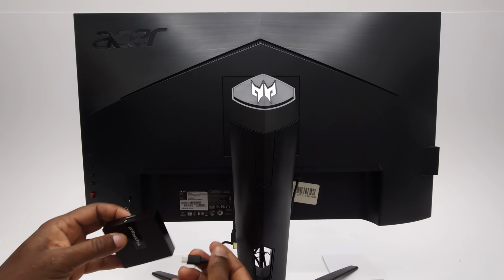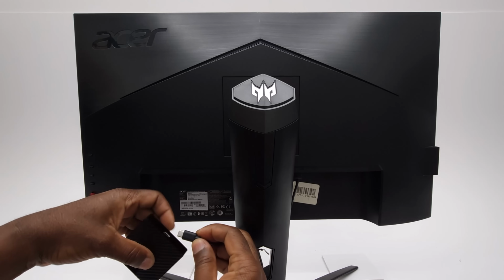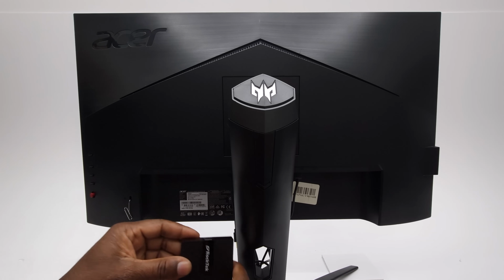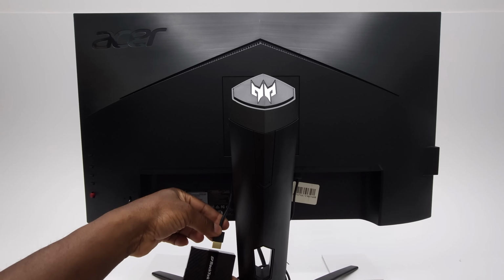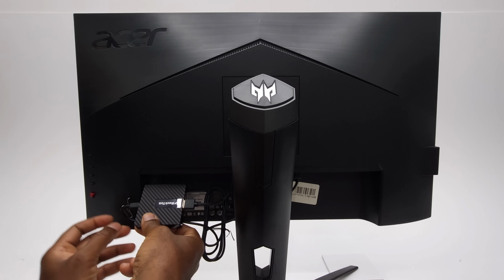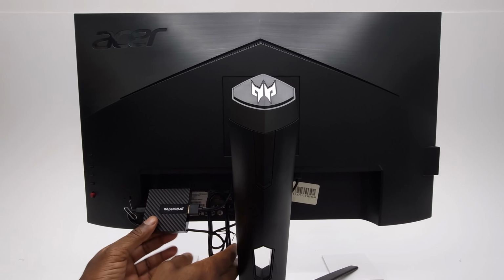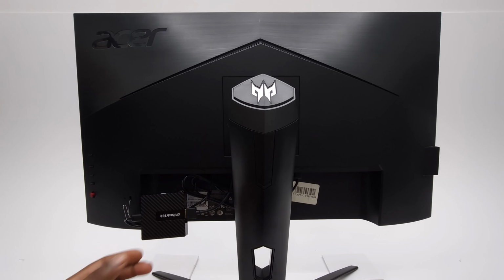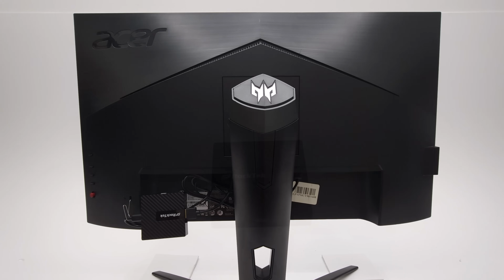This is because it's designed to sit behind your TV or monitor and be powered by one of the 5V USB ports. And the 6-inch HDMI cable is sufficient to reach one of its HDMI ports, and it also provides a neater setup. You do, however, have the option of using a separated DC power adapter and a longer 36 inches maximum HDMI cable. Anything longer might lose signal.